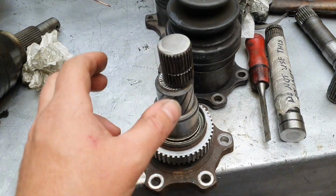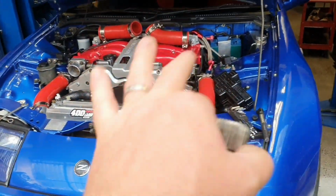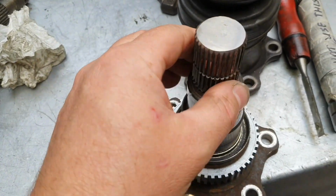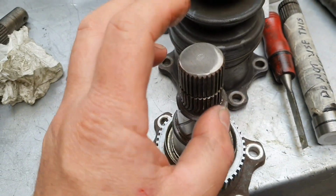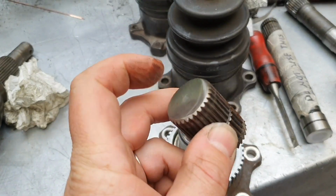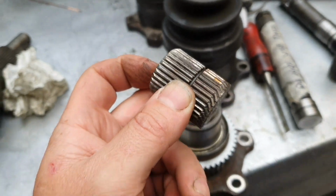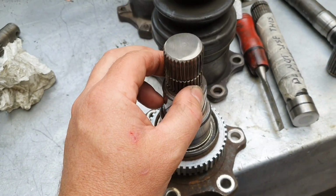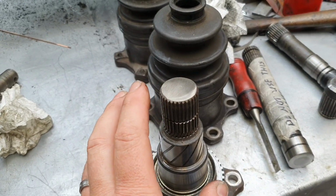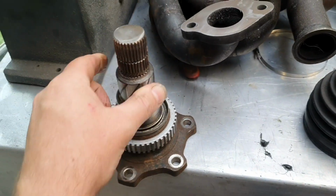Now this other thing here, this 300ZX, this one, I've started doing some other things that we're going to do, but yeah, that's what happened to that. Inside the old differential. Now, the instructions are that you've got to cut this off, cut this shorter. This is actually quite a bit longer from factory. Just wondering when that was cut, whether there's a bit of heat gone into that. Done some things to it, so when we put the new one in and I cut it, I'll just be very careful about how much heat actually ends up going into that particular piece.